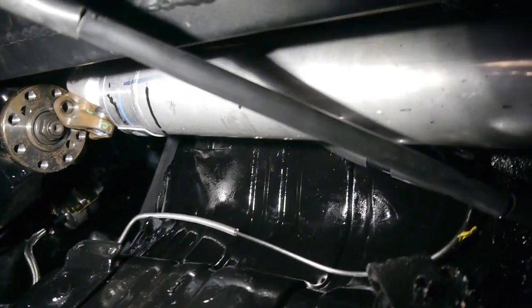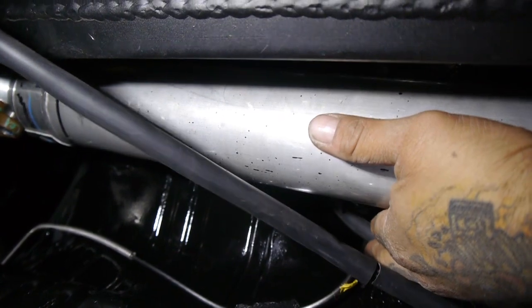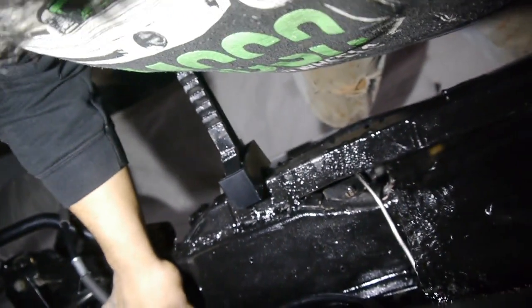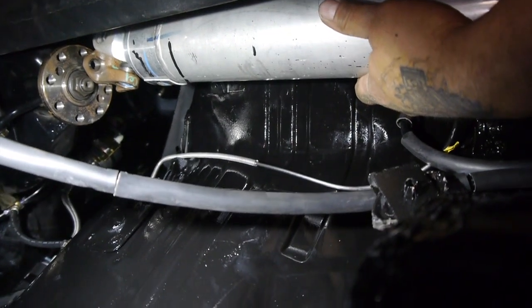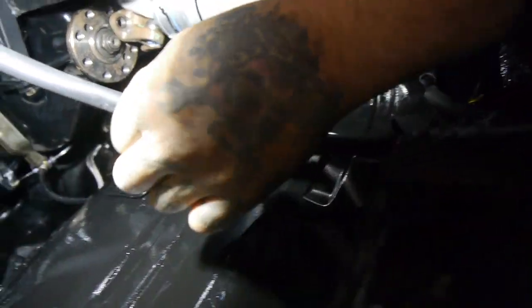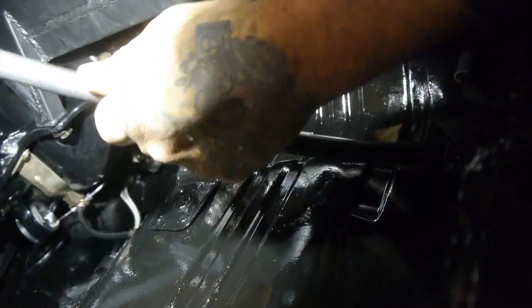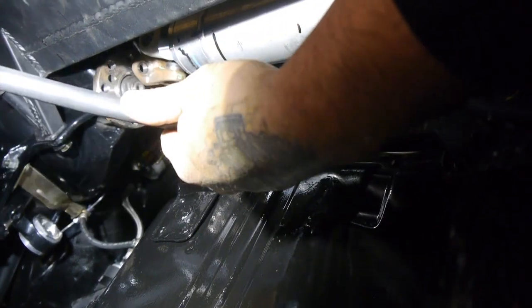And now, all I have to do is come back down here with some clamps and figure out the routing that I want these bad boys to go through. Something like this maybe, make it look as cool as you can make this rubber slash metal line look, and then come around this side and do the same thing, and we should be okay. We also picked up a couple of the coated or insulated clamps for these to give it a little bit more firm grip. So we're going to install them the same way with the thread chaser screws that we used up here, going into the frame or the side of the floor, and then clean it up as we go upstairs.